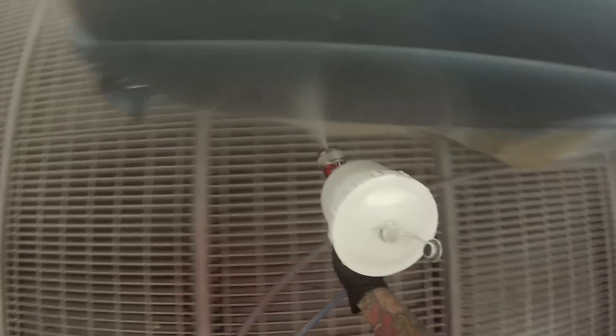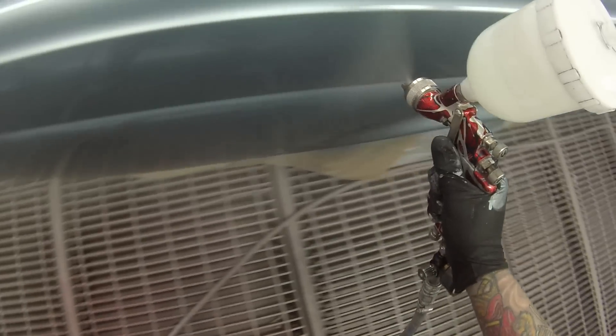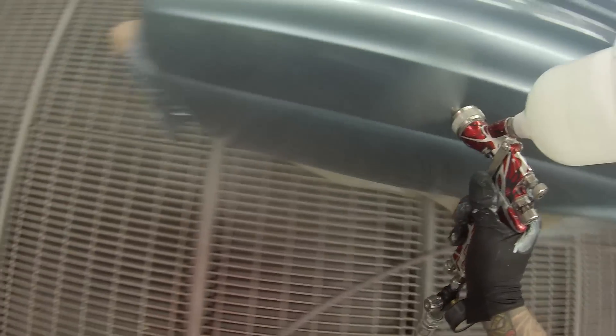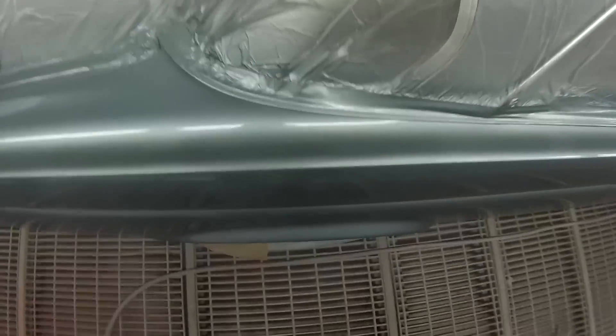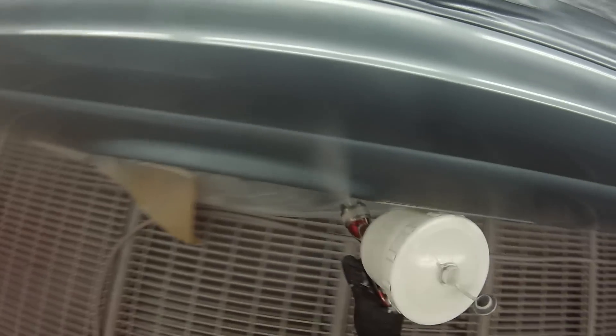Set fans up if you are to do it at home, and use filters. These fumes are highly flammable - it's also an ignition point - so don't sit your heater next to the car. It is dangerous stuff: dangerous for you and dangerous for the environment. There are other ways of doing it - you can do all your prep work at home and then hire out a spray booth. There are places in every major city that have spray booths that get hired out and for a daily rate you can go in there and do your own paint work.